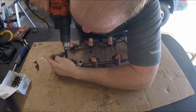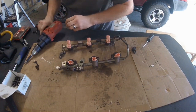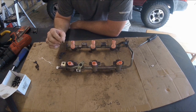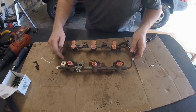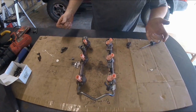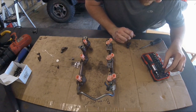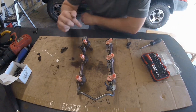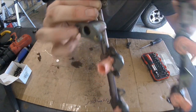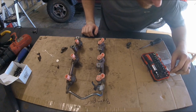I'm going to try my luck using the drill... nope, that one's stripped. I did get that one out though. This is actually the perfect example of what happened with my original fuel rail - I got one screw out and that one stripped. The way I extract stripped screws is by finding a better bit that can bite into it. Since the Phillips head is rounded out, I'm going to find a star bit or a square bit that I can hammer and tap in there to get more bite.